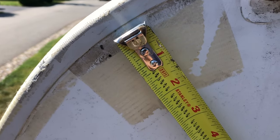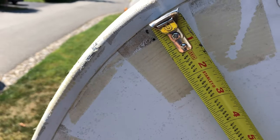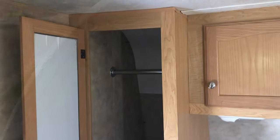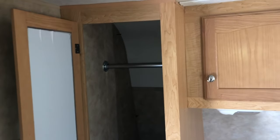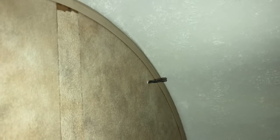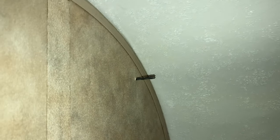So I'm going to try to drill my first hole in this corner here. I ran it about two and a half inches off. I just drilled the hole through — I have the drill bit sticking through the wall, and here's the closet that I'm in. I can see my drill bit, so I'm pretty good. I actually stayed two and a quarter inches off the edge. I could probably have gone about two inches, but I'll put maybe three or four bolts in that radius area to hold that down pretty tight.